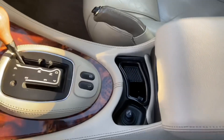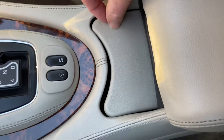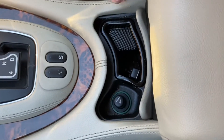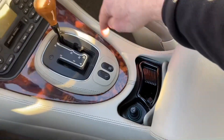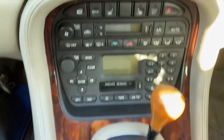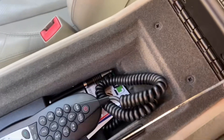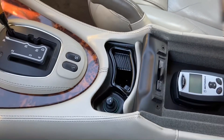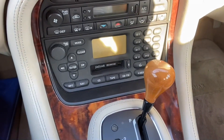When you've taken all those off you get to the ski slope, which is this wooden surround, and then we should carefully be able to prise that out. There's a little flat lug underneath here so I've got to very carefully lift the ski slope up and then out. The other little job I want to do on this car is the cover on the ashtray, which I think a lot of people may have had problems with. I've got a replacement for this but I'm going to film that on a separate occasion.